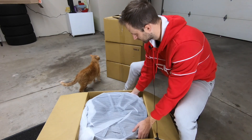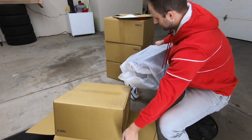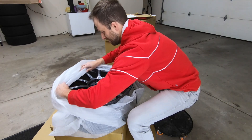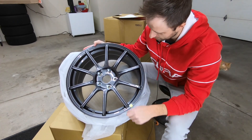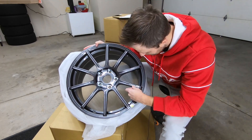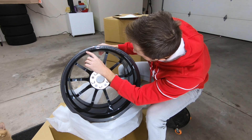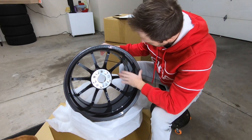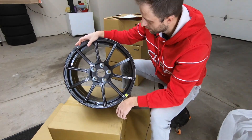They actually wrapped the wheel completely. There's the center cap. I'm going to flip this — and there it is. 'Forge Type R.' That's kind of cool. It looks like a sticker that they cleared over because you can feel it's raised; it's definitely not milled into the wheel. Still very sharp. Honda Motor Co. LTD, 19 by 9.5, plus 60. So that's what I thought — a 60mm offset, they didn't change that at all. It is very light for an OE wheel that's 19 by 9.5; this thing is really light.